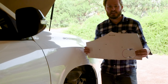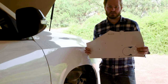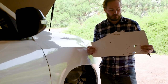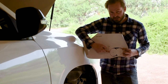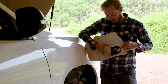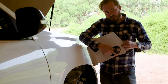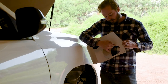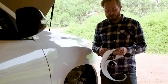What we're doing instead — another way I like to do it — instead of purchasing an 89mm hole saw, which is going to be a little pricey and probably only have this one use, we're using an air body saw. To do that, we've continued this oval using a texta and cut it out to end up with just an oval. Onto the guard, we're going to trace around that oval, drill maybe a 10–12mm hole in one corner, and then just use an air body saw to go around.